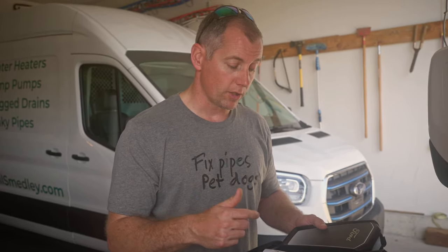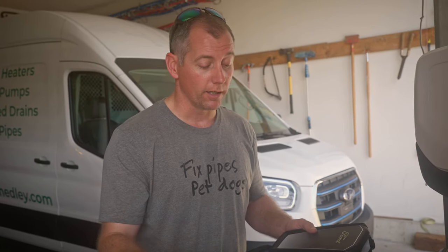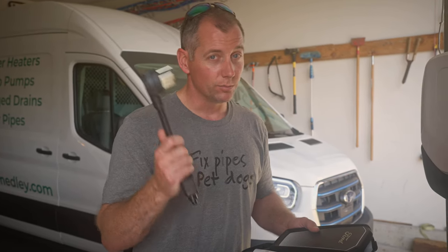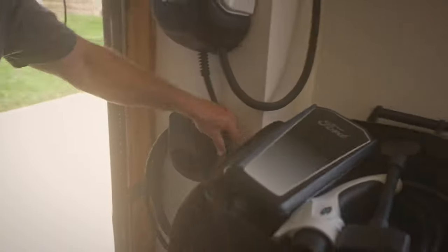We did a video recently showing the approximate charge times. If we plug this in to the standard wall outlet, it takes like 74 hours to charge it from zero all the way back up to 100%. That comes out to about like 1.5 miles of range per hour of charging, and that's using your 120 volt plug. Yes, it does come with a charger from the factory. If you want to use the factory charger, you really need to have at least a 40 amp outlet to do so. We sprung for the extra Ford connected charger over here.